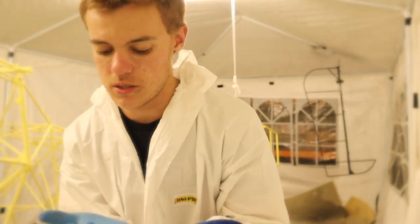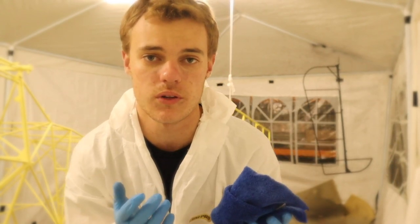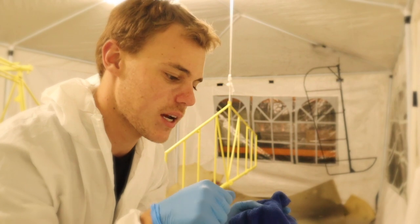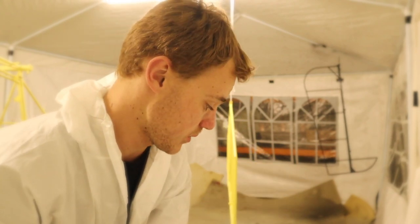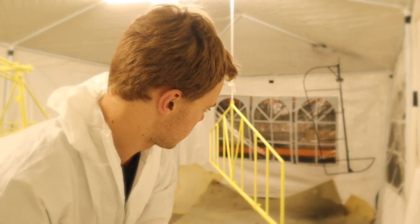The reason I'm wearing gloves is because the oil off your hands goes onto the paint if you're not wearing gloves. The wax and grease remover — yeah, the only reason I'm wearing gloves is because the oil on your hands goes onto the primer. As you wipe it you've also got to hold it, otherwise it does donuts, so then you're grabbing it again and putting oil back on it. It sort of defeats the purpose of wax and grease removing whatever you're about to paint. These are cheap — wear gloves and it'll save a little bit of oil going onto the primer after it's been sanded. We'll cut to painting.